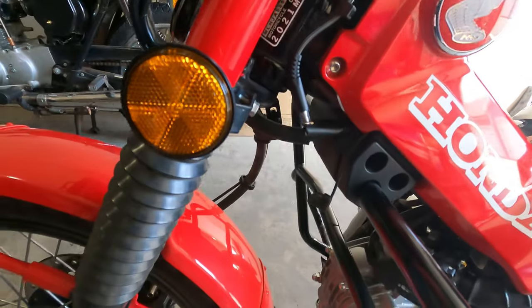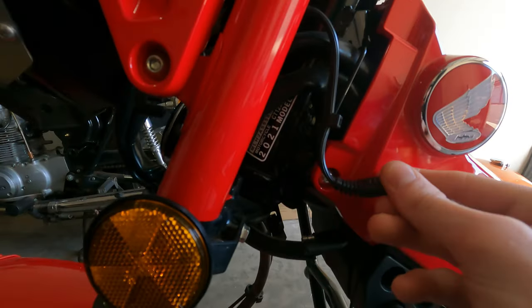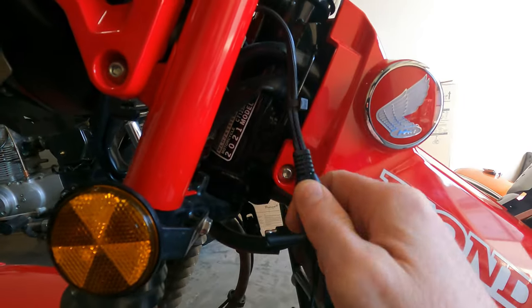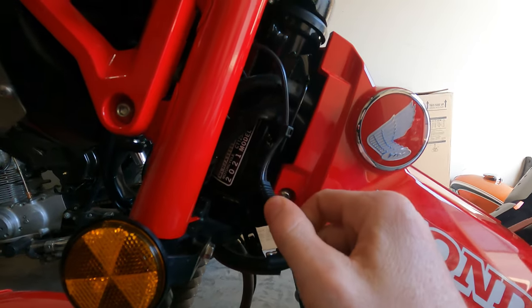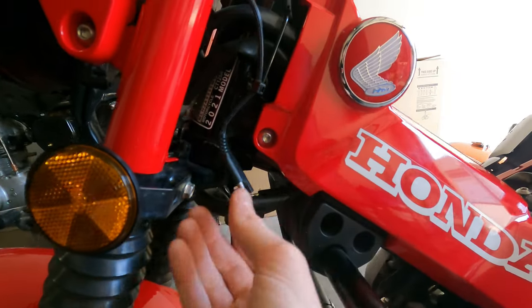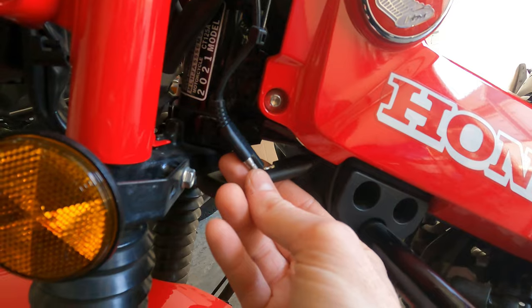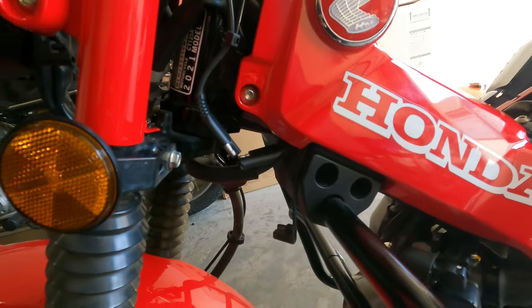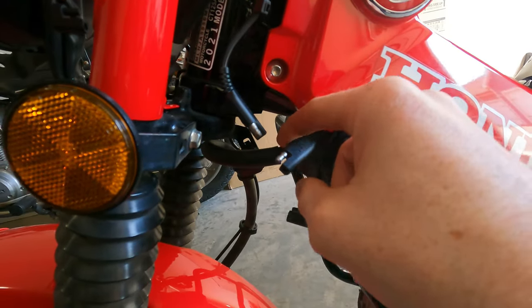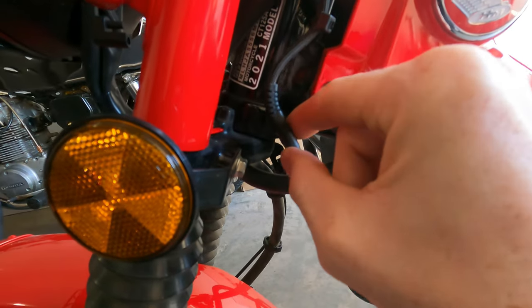The other thing is that this allows me to unplug — basically I took an SAE cable and ran it the opposite way so that the negative is the positive and the positive is the negative, so that I could merge the two here like I would plug in the battery tender itself. So this lets me unplug and plug in my battery tender, or plug it in when I'm out for an adventure and charge off of the battery.